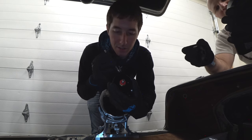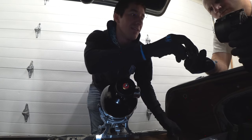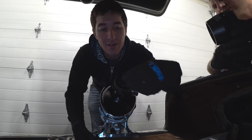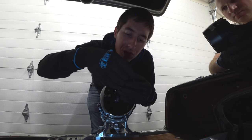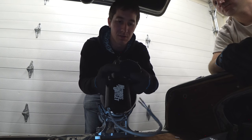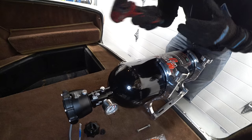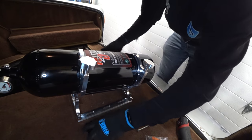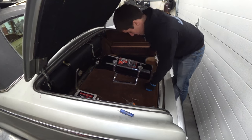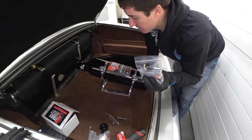That way we can put that down. There's a screw hole right there, straight up and down. Slide this on here, nice and tight. And then we put on this knurled valve handle that allows the remote bottle opener to open the bottle. Once you get this on, put your nut back on there. Now we just need to run the motor to close the bottle. This set screw on top holds everything together. 15-pound bottle, billet bracket, with a built-in bottle heater that's so stealthy — and we still have trunk chrome. We've got tons of clearance and a 15-pound bottle in the back of the Rolls-Royce!